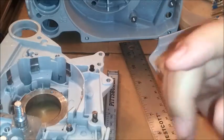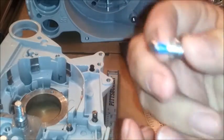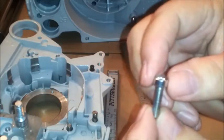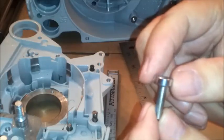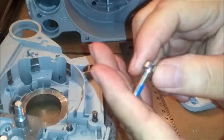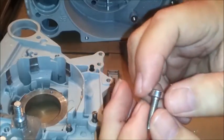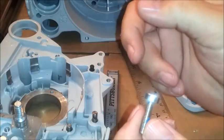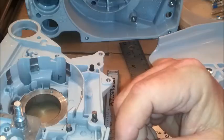There's something on both fasteners — on the P fastener, which is for the plastic, and on the metal one. When you start the screw, the way they want you to do it is to always rotate it backwards until you feel it drop down into the hole. Then turn it clockwise and tighten it down. That's true whether you're putting it in metal or using it in plastic. That's an important technique — it keeps you from messing stuff up.